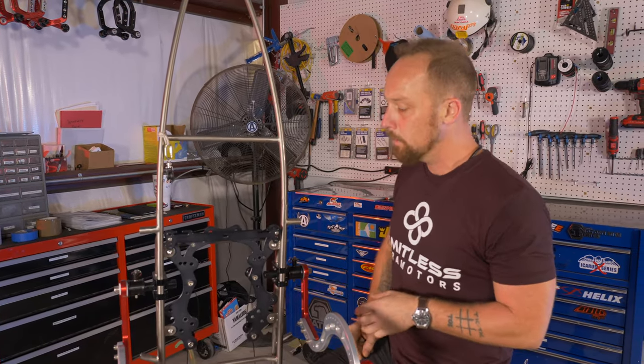First step, grab the 5mm ball end Allen. So you've got four screws, two on top, two on bottom, that go into this slot here. And these are just set screws to lock this shaft in place. When you're using a ball ended Allen, be careful not to pop the ball end out of the socket head of the screw, because that's kind of the downside of the ball ended Allen. It's a little bit easier to round that out. Loosen up all four. I'm gonna wanna back out all four of them about 3/16 of an inch, something like that.